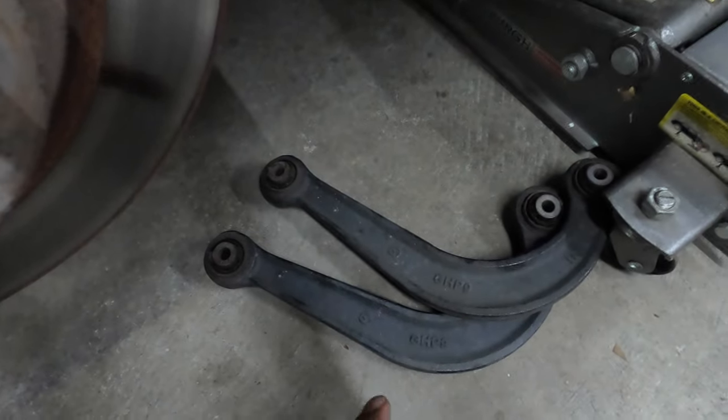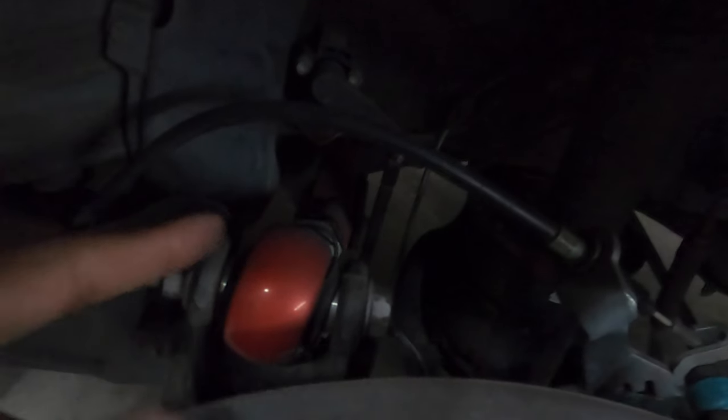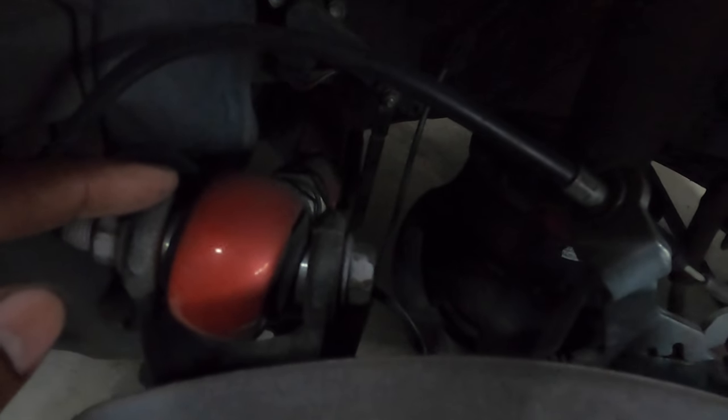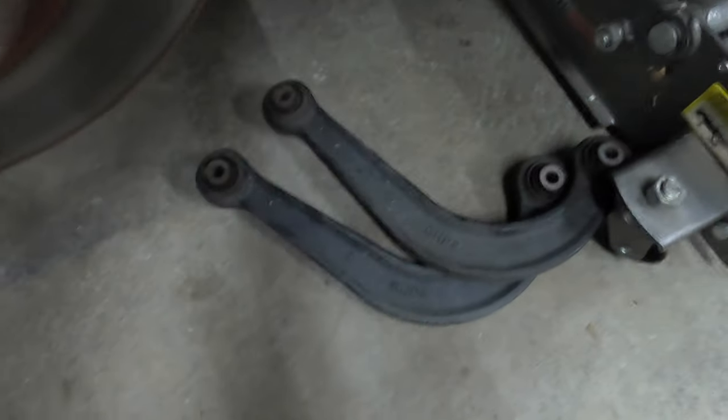So this video, you are going to get me switching out the Godspeed adjustable camber arms back for the stock camber arms, because I think one of these is froze up, and Streamline Performance in Concord, North Carolina could not get it to loosen up. So I'm just going to take them out and put the factories in, because with the BMW style 95s, they are 19 by 10 plus 25. So I actually need the extra camber to run those wheels because they are wide and the offset is a tad bit aggressive for this car anyway.